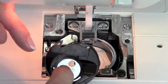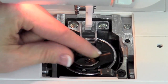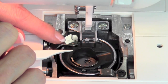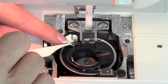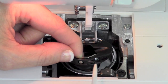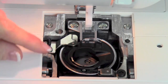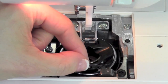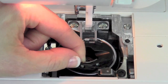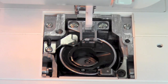To put this all back together, it is key to get two places lined up. First, these kind of pointy ends go towards the needle. Once it's in there correctly, there are two things to look for: number one, there's an arrow on the silver part and an arrow on the black part of the bobbin case — those need to point to each other. When those are lined up, you'll also see the second part. Right down at the bottom there's a little heel. That heel needs to be on the left side of the spring to be properly positioned — it will have a little wiggle, and that's perfect. Many people get it in opposite of where that little spring is and it just doesn't work, so make sure you look at those arrows and the little spring.